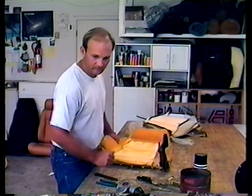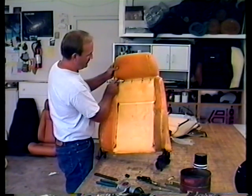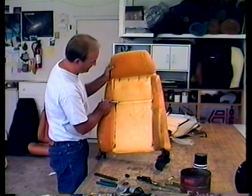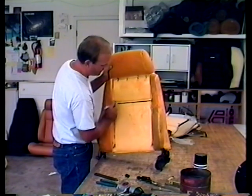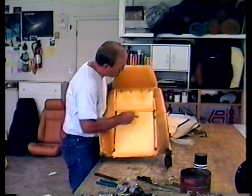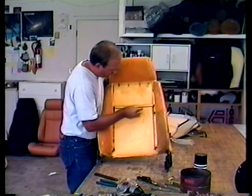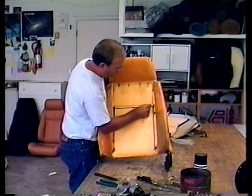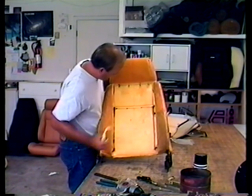To prepare the back rest, take that magic marker again. This line can be reused — they hog ringed it down from Pontiac that way. There's one right here — you can see it sticking out the sides. It's where that little loop is that you stick the rods into. Take a razor blade — you can feel the wire. Just cut this back a little bit and take out the foam.